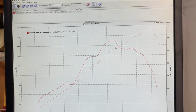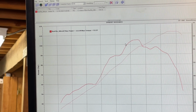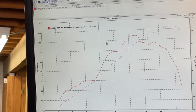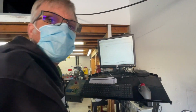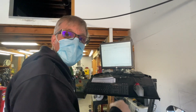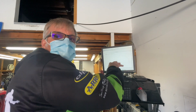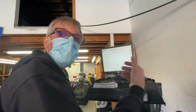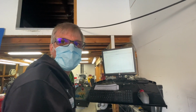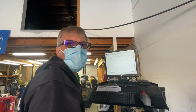What we want to try to stay away from is very steep accelerations of torque because that's what initiates spin. Now also keep in mind that what we're measuring here is not inclusive of the traction control electronics because they have to be turned off to operate the dyno. So we can mechanically bring this as close to optimum as we can. However, we can't really measure what's happening on the street because we're not overlaying the electronics. The electronics may patch up and fix a lot of this, impossible for us to see here.